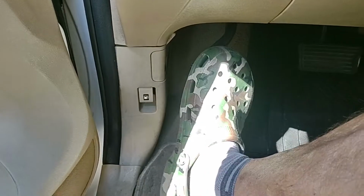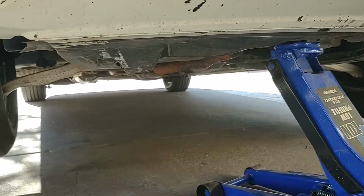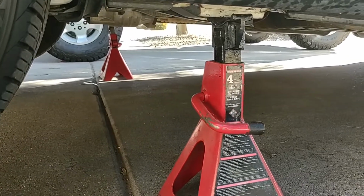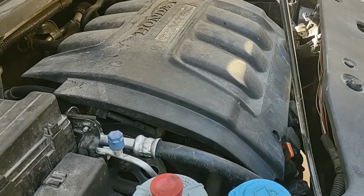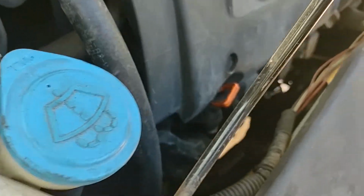Next step, car in park, emergency brake on hard. Next, floor jack, lift the vehicle off the ground. And then jack stands under the lifting points. You don't want to skip this step, folks. It's important. Okay, this series of engines, the 3.5 liter V6 Hondas, have generally four O2 sensors, and the front ones,